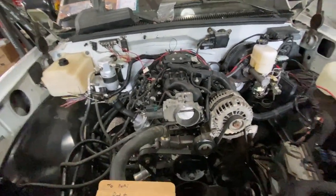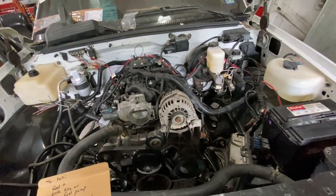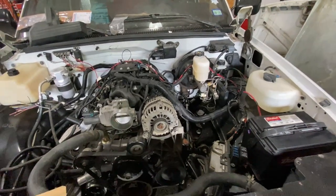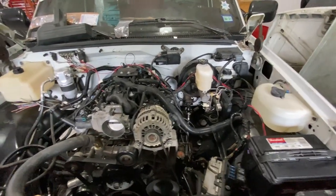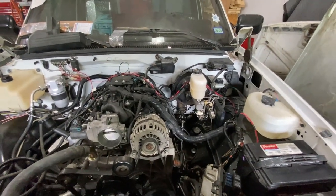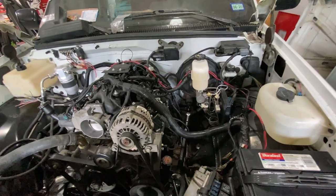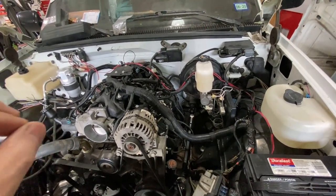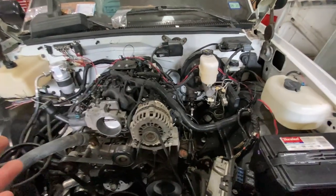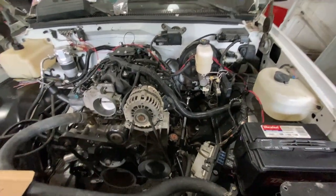Now let's look at some of the other wires that would make all my gauges work. For one thing, the TCC — in this case I don't have a need for that because I have a manual transmission. If I did have a TCC or an automatic transmission, I would need to find a wire in the system that is hot originally, and when you depress the brake pedal, or no power. So I would have to do some searching to find that, but with the help of my schematics, I could do it.